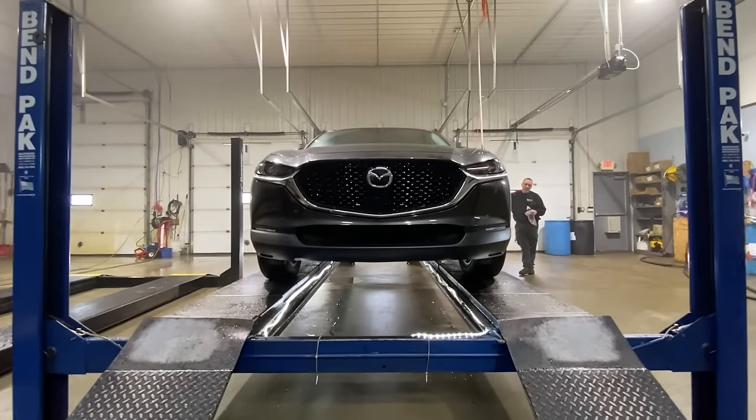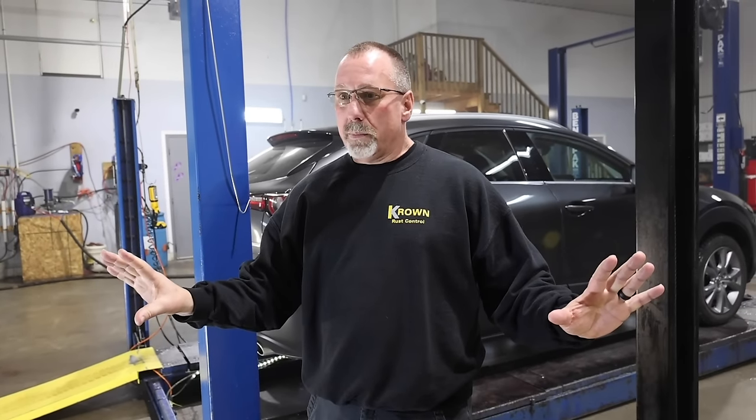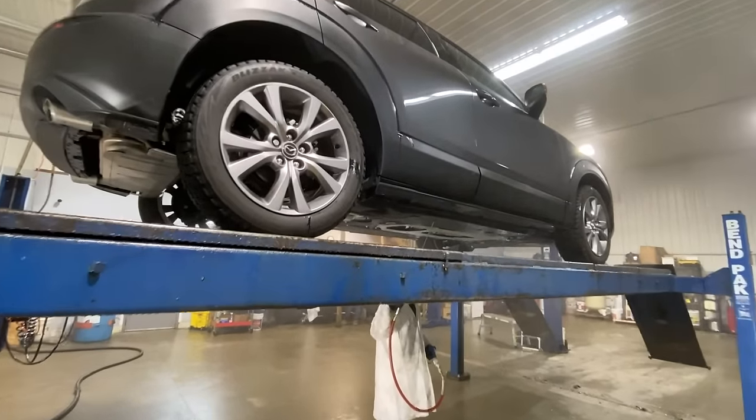The philosophy that Crown has is the oil has to be almost as thin as water to get into the same areas water can get into. You take a thicker product and you spray on a door seam — is it really penetrating the door seam? Is it getting that door full? You've got to have a real thin product, and we heat the oil also so it's really thin when we spray it. That is the biggest benefit — why the product has to be thin.